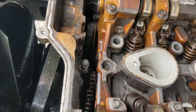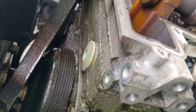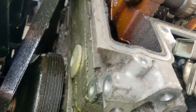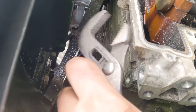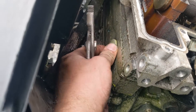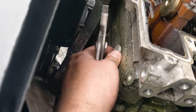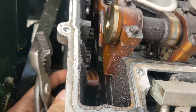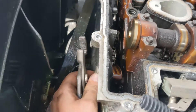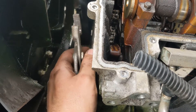Make sure you don't forget the three bolts in the front. You're also going to have to take the plugs off the front of the head and get the bolts that hold the timing chain guides. To do that, I normally just use a regular pair of channel locks because the Allen head in there almost always strips out. Once you break it loose with the channel locks you can just unscrew it — it's a 10mm bolt in there. If your junkyard is smart, they already took the cat off for you. That should be the last of the things that'll get you, and then the head should come right off.